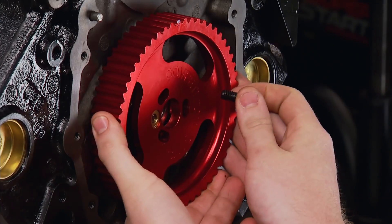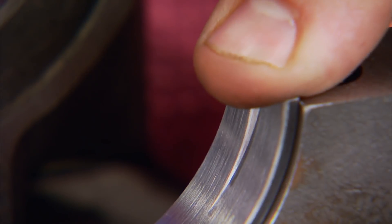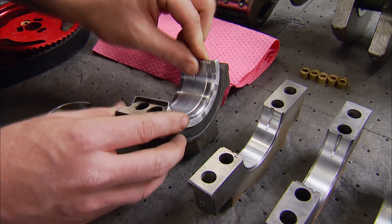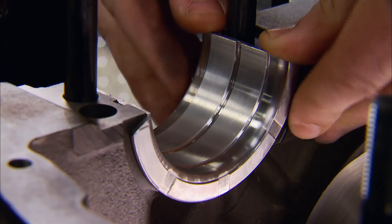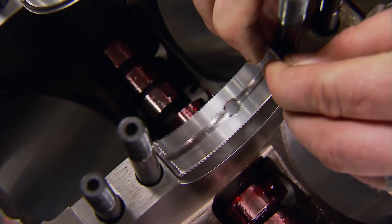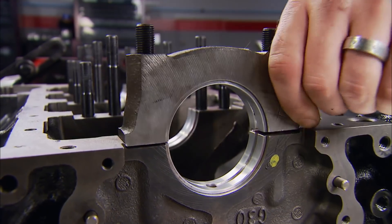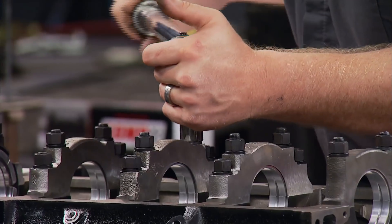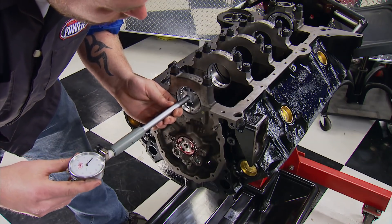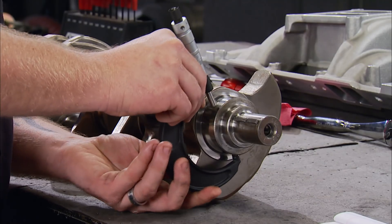I like to put the cam gear on and move it to the installed position — I'll show you why in a minute. The next step is to install our main bearings. These are three-quarter groove high-performance bearings from King. Even though I line-honed the block, there can be a small variance in size between bearing thickness as well as crank journals from when it was ground, so sometimes there's a slight difference in clearance between journals. Without the crankshaft, all the caps and bearings need to be in place and torqued to spec, then one by one get a reading of your inside bearing diameter and write them down.